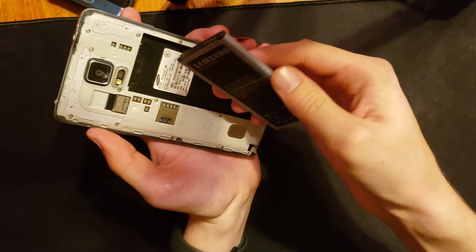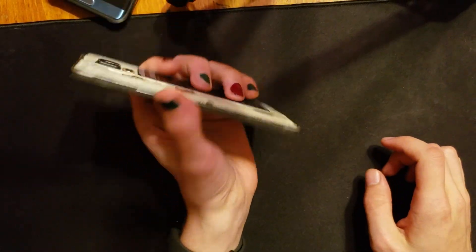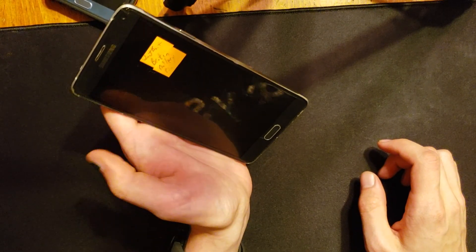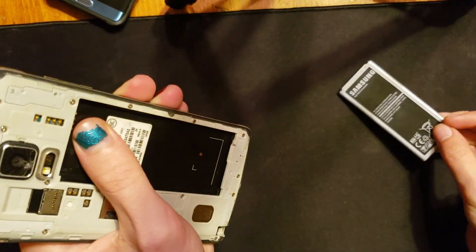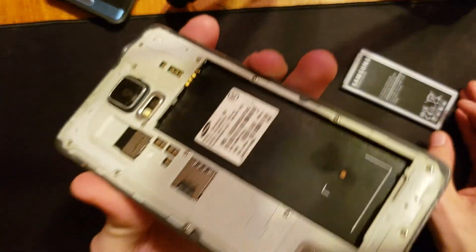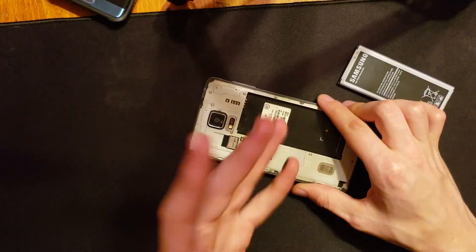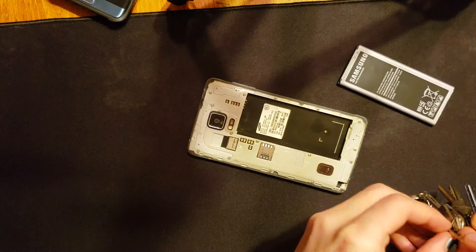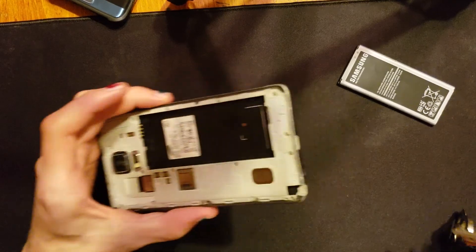When I connected it up to the charger, the battery icon would pop up and then it would just go flat again, and it would never get past that — it would never boot up. That's because this battery pin was bent, so I just fixed it. Unfortunately I can't really re-demonstrate this, but I will show you exactly what I did because I did not expect this to actually work.